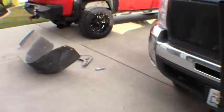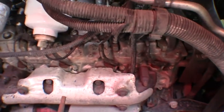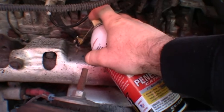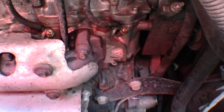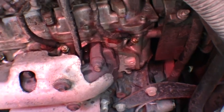We've already got the passenger side liner yanked out. I can get up in here and show you the glow plugs — here's why they're so accessible on this side. You've got four laying right in there with the little threaded nut. These look pretty clean. Mine had significant rust and buildup. I'm going to go ahead and spray some penetrating oil on these and let them soak for a minute. I actually twisted one of those off on mine — it's a tiny little head and it twisted right off. If you feel like it might twist off or slip, stop and try a different approach.